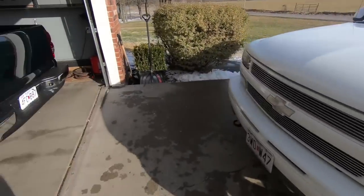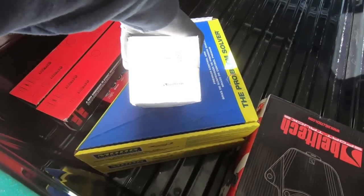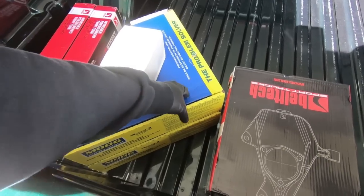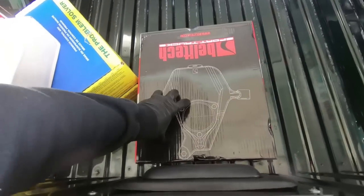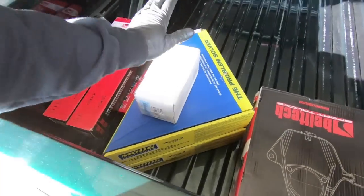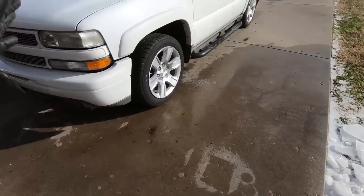Now for the front, I bought a couple things. I bought torsion bar keys, which you see here. I bought new upper A-arms to fix the camber issue, because you're gonna have a lot of negative camber. The wheel's gonna wanna lean in. And then we obviously have new spindles. So for those three things, for sure I'm gonna put the spindles on and the upper A-arms. I'm not sure on the keys because we're really close to level, I think, once we get the spindle on.